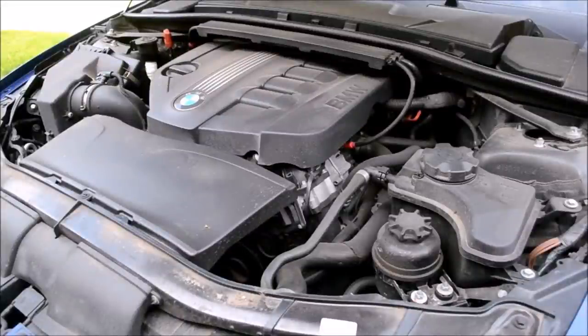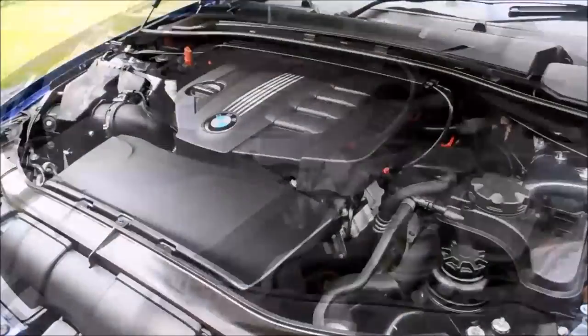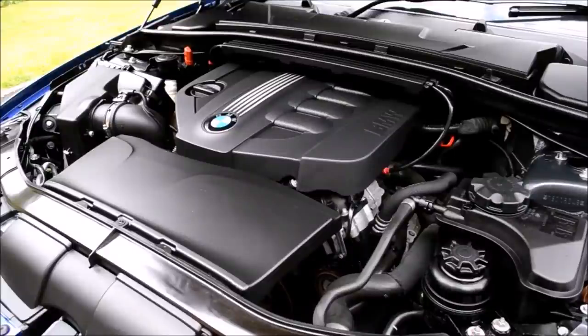If you're doing this as a job or even part-time at the weekends, make sure your business insurance covers you for engine bay cleaning. The condition of this engine bay only required a medium strength chemical detail. For older vehicles, and particularly high milers, you may have to up the chemical strength, and for me, if this was the case, I would jump straight to Meguiar's degreaser diluted somewhere around 4 and 6:1. You can use a steam cleaner, however I find a pressure washer is far more efficient.